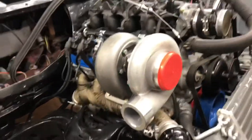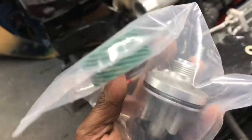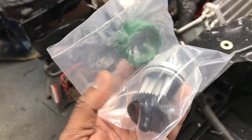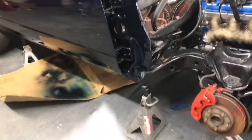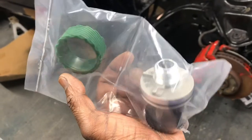What up YouTube? Mr. Random checking in gang. It's a big video. I'm going to go ahead and install our drive and our driven gear. You see it came with the housing as well. It's a 42 drive, 15-2 driven. Just a drive right here, this is driven. So I'm going to get this installed on our TH400 transmission to get the proper speed reading on your dash. So tune in gang, comment, like, share, subscribe. Let's get it.